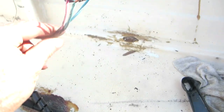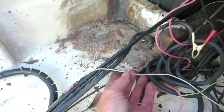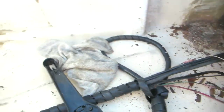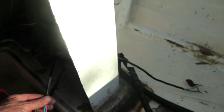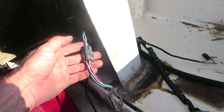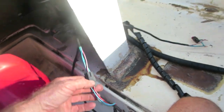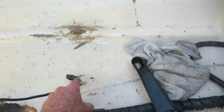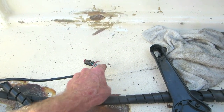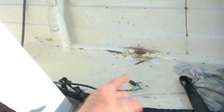Very important: the wire between the motor and this switch runs down here, but it doesn't run right up to here — it runs into a connector. In my case that turned out to be the problem. I had no 12 volts here. The way the motor runs: you have 12 volts and you swap grounds — that's how the motor goes up and down, runs either way.